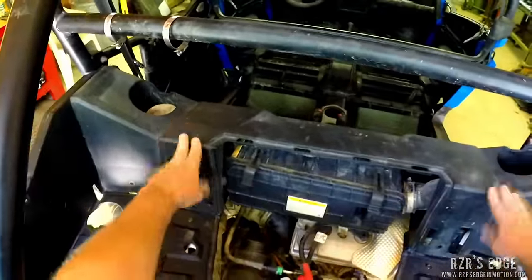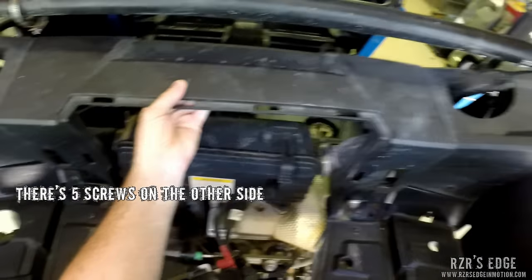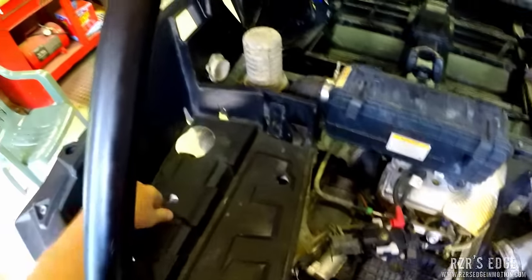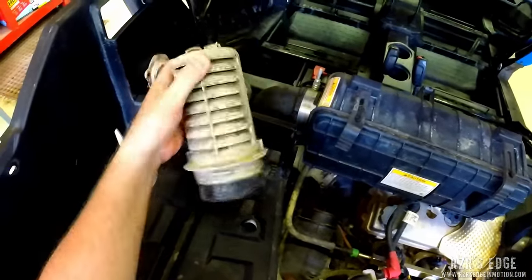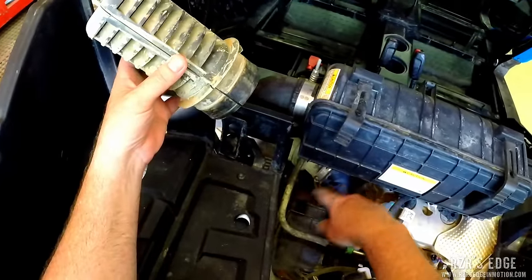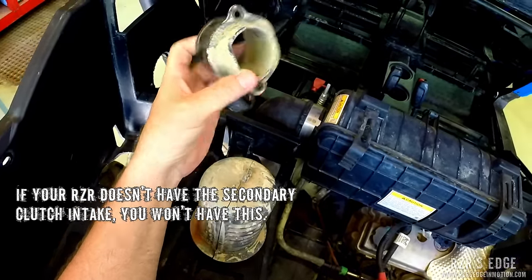The next thing you want to remove is this cover plate that covers up basically the intake system. There are just four screws here and four on the other side. Just take those out and the thing should just lift right out. Now here we have our engine air intake — one hose clamp, just take that thing off. Here's the belt intake piece. You can see how nasty it is from splash water coming in through this side vent that it's not even connected to. There's also a clamp down there where it connects to the boot that goes to the clutch intake. Take the clamp loose and take this thing off. Here's the secondary intake again — look at the nastiness, the splash water gets down in there. Take that off too.